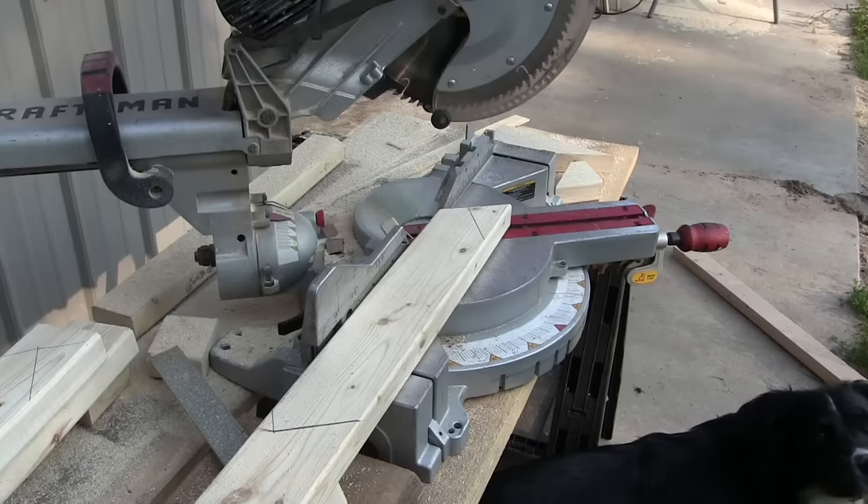I'm stapling my insulation to the inside edge of the board so that I can glue my paneling directly to the ceiling. I tied some string to each one of the wires hanging out of the ceiling for the lights, so we could feed the string through the paneling before we even picked it up and be able to get a hold of the wire easier. I used a staple gun to hang all the sheets because it's easier to shoot a staple and hold a sheet up than it is to drive a nail. After I was done stapling them up, I went through and nailed them all off with paneling nails — little bitty ring shanks, so they should hold pretty good. Plus everything is glued: all the ceiling panels, all the wall panels, and all the exterior wall panels.